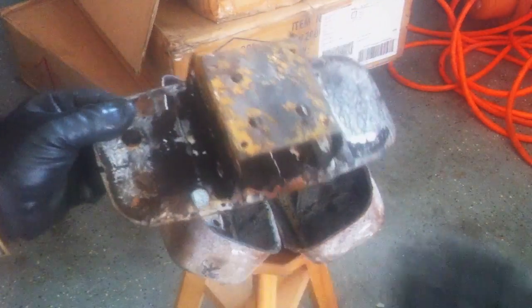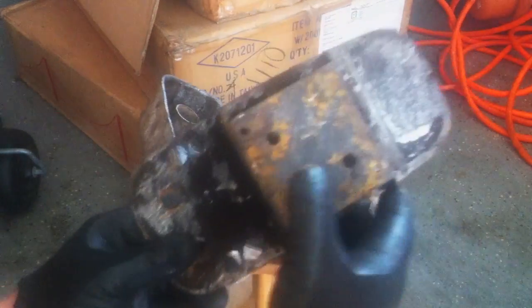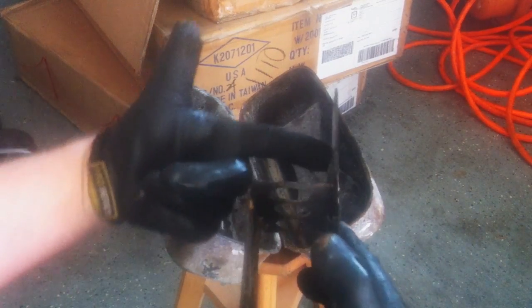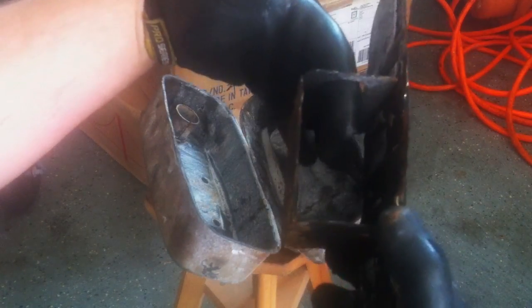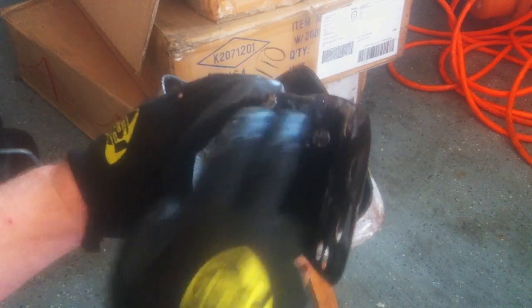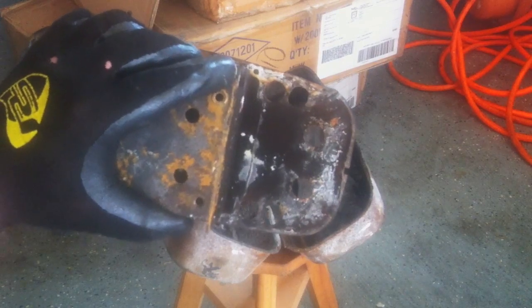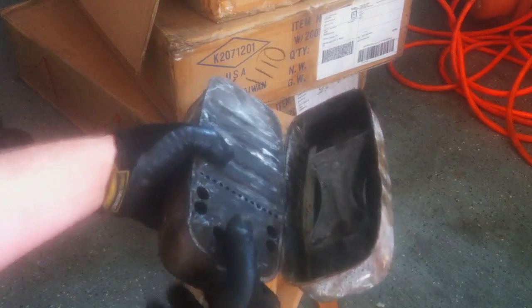It routes exhaust — nothing else in there. On this model there was a specialty plate for my motor that goes on the back at an angle to attach and wraps around the motor. This is where the intake comes in — your exhaust comes in, hits this lump of perforations, goes through these three perforations, again through this box area, comes through smaller perforations, then through some outer larger holes, comes into this chamber, and goes through those holes and comes out.